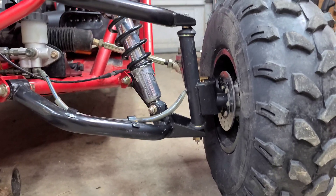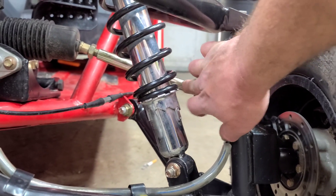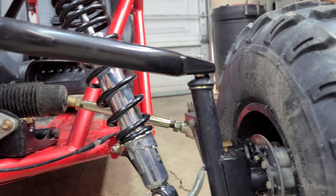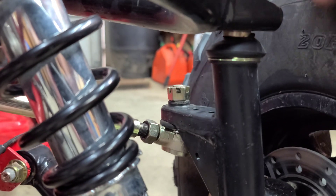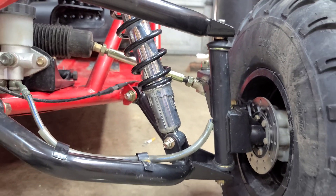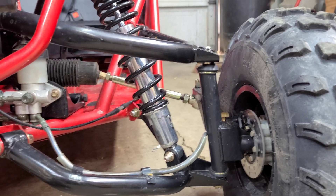We've already fixed this side. If you look, that tie rod end — that's the gold piece right here — if you look at the alignment of it, it's aligned up with the upper A-arm. It's a little off on the lower A-arm but it's really close. The problem was the tie rod end was on the top, going in from the top, and the nut was on the bottom. So it wasn't aligned correctly, and when he hit a bump the tie rod end was actually pushing out on the tire and making it bump steer — turning the wheel without him turning the steering wheel.